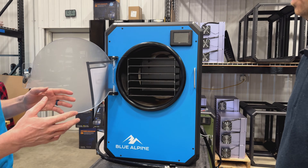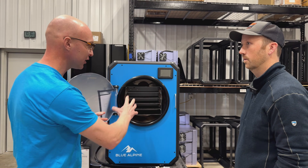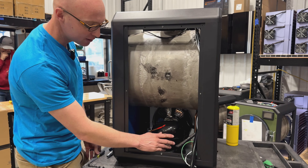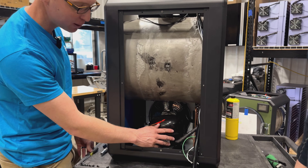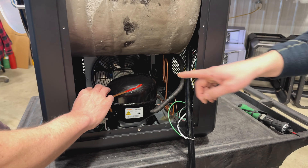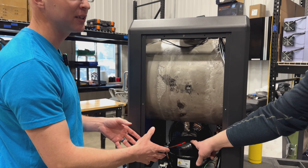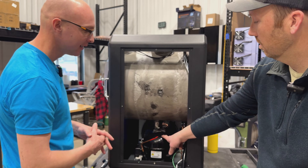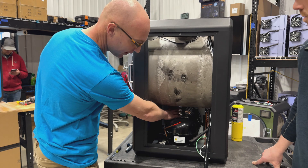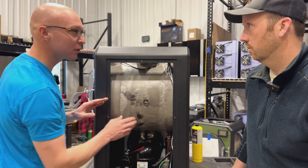The other part is the vacuum pump — that's what creates the vacuum. But if you don't have a good seal or something's wrong with the chamber, you can't get a good vacuum. The refrigeration system is really just the compressor and the evaporating coils, and the condensing unit. This is the compressor — it compresses propane on the inside. That's the condensing unit. Hot refrigerant flows into this and gets cooled off by the fan.